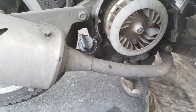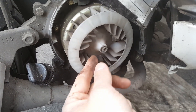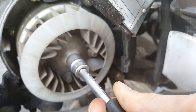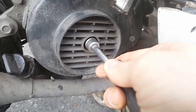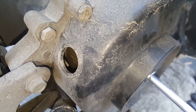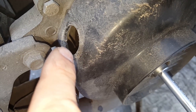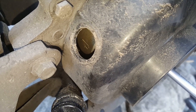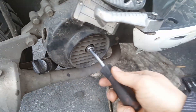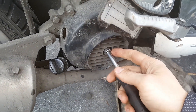Here's a trick: on most scooters you don't even need to remove the cover. There's usually a nut here that you can turn — in my case with a 13 millimeter socket — and you can reach it through the cover. You can also see the markings if you just remove that rubber cap. With some light you can see the notch and the T marking pretty well. So you don't need to take anything off — just pop the rubber cap off and turn the flywheel. This should work for most scooters, unfortunately not all, but most of them.